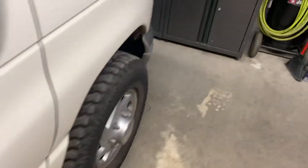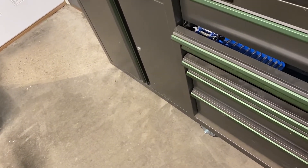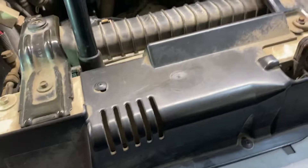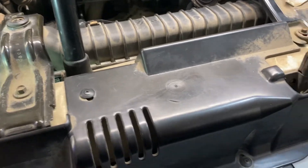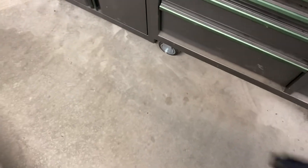It's a pretty tricky job — removing things for access is the big part. You also really want to be careful because these engines are notorious for spitting out spark plugs, and re-threading them is not a fun process — especially in the vans where there's very little room to work. The fix involves a large tap you'd drop in with a socket, and a helicoil punch to set the insert. The tap is currently missing in action from my toolbox.